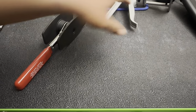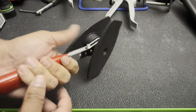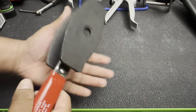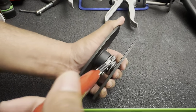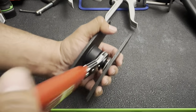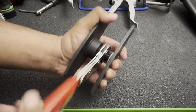Now, in the second video, you guys saw this Snap-On in action. This is also USA made. That's your part number there. And this one I picked up to use on four piston calipers, because it'll work on single, dual, or four piston calipers. You basically put it right in, and as you ratchet this, it'll either make the tool smaller, as you guys can see there, but it's got a little trigger there. You just push it, and as you ratchet, it'll make it bigger, compressing both sides of the caliper if you have a four piston, or compressing the single or dual on one side.